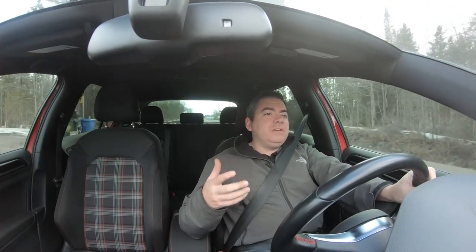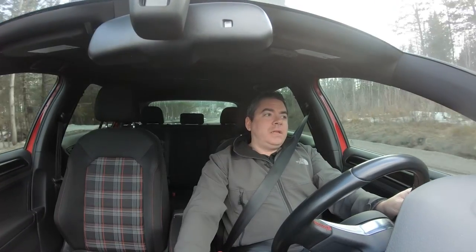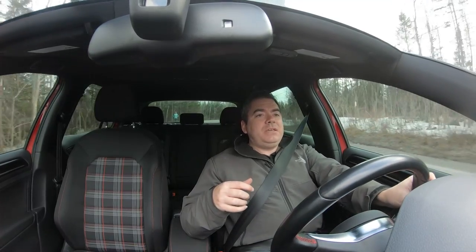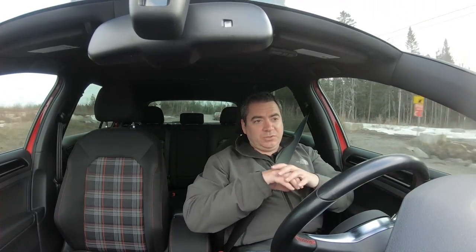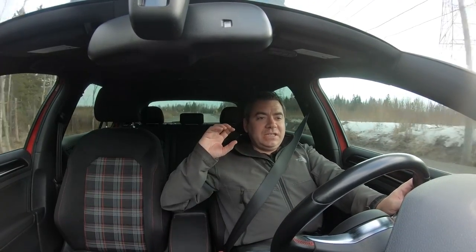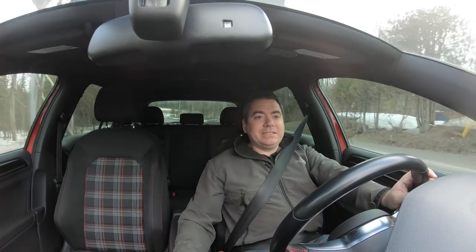So just even getting on the main road, it feels to me like the car is slightly more responsive. Now we're feeding more air to the turbo because the turbo inlet is bigger. So I would expect this to be about equal or even a little bit laggier than stock just because there's more air volume, but perhaps there's so much of a restriction on the stock piece that just the air getting to the turbo makes it feel like it's a bit more responsive. That's the only thing I can see right now.